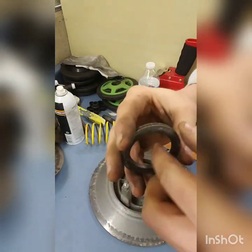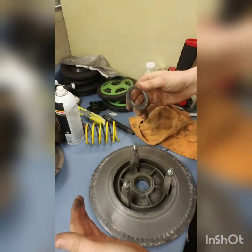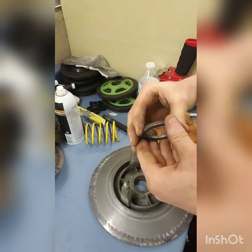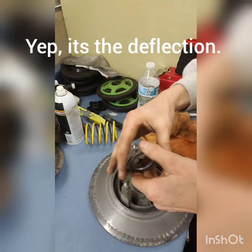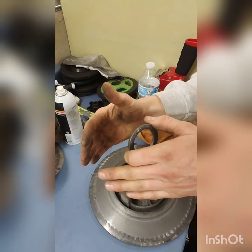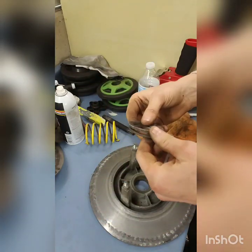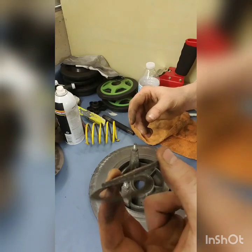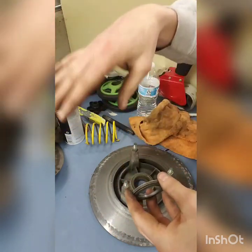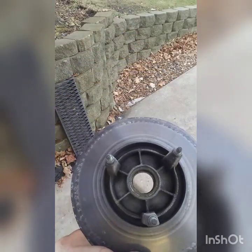Back to these fancy washers — the reason you don't want to lose these is you're setting the spacing to set basically where the belt rides in the sheave when the sheave is fully compressed. Since this is the moveable sheave, as you speed up it widens out to change the gear ratio. Based on how the motor is mounted and the age of the belt, you might have to shim your sheaves open or closed to get the belt to sit inside the sheaves the right height. That's why those are important. Clean these clutches out more often than this, folks.